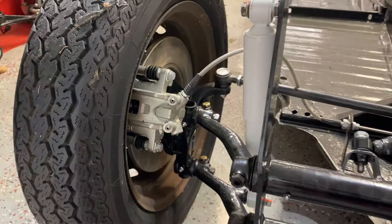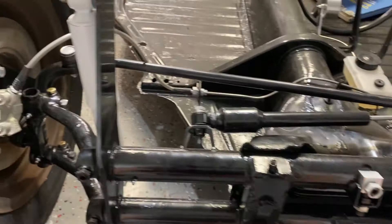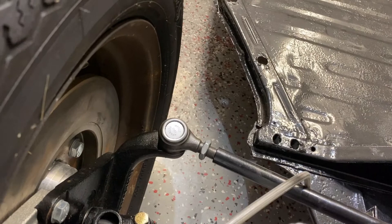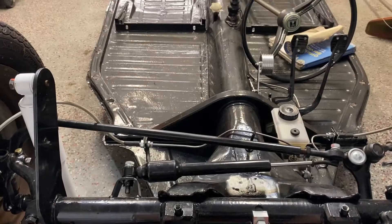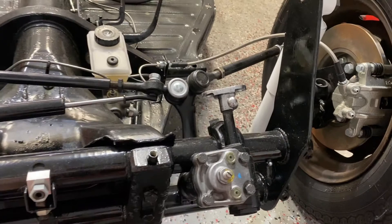I already had the trailing arms. My recommendation is to definitely get German tie rod ends, because the other ones are garbage — I bought some and they started to leak from the top, which was weird. I also ordered tie rods from them that are meant for a 4-inch shortened beam — German stamped. I also have a TRW steering gear box. I took all the grease out of it and put better grease in.